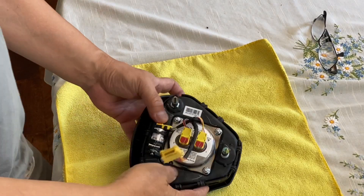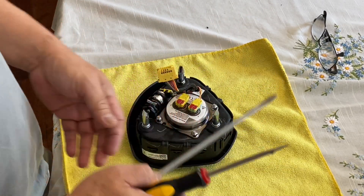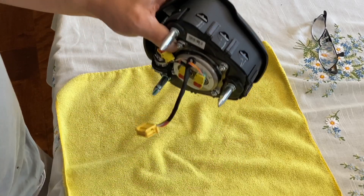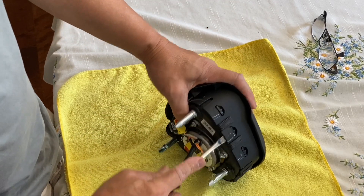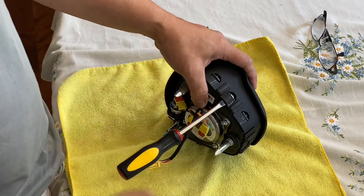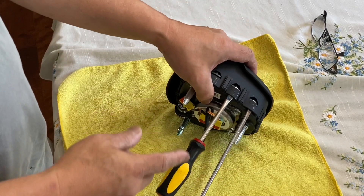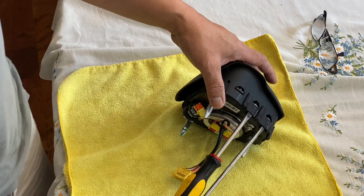In order to remove the airbag cover, we'll be needing a bunch of screwdrivers — about 10. The reason is you see these tabs? We need to lift them all at the same time. If you only have a few screwdrivers, once you lift and remove one, it's just going to go back. Since I don't have enough screwdrivers, I'm going to use a butter knife or anything I can insert in there.